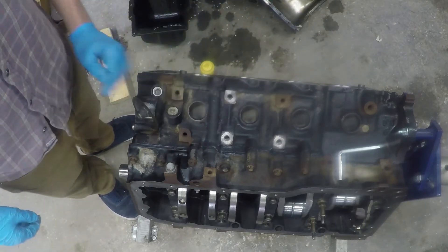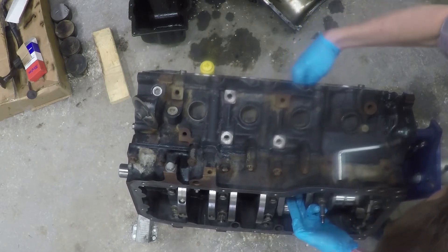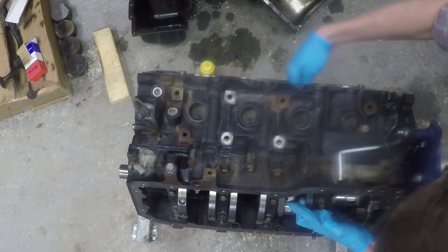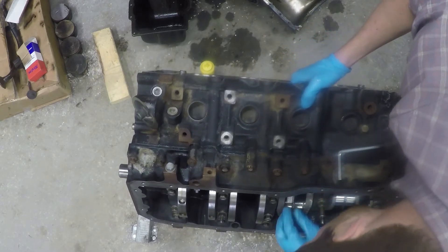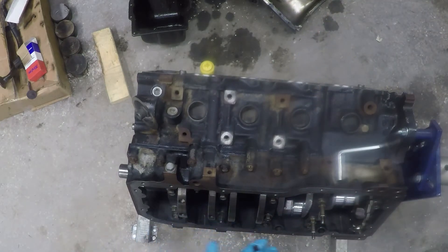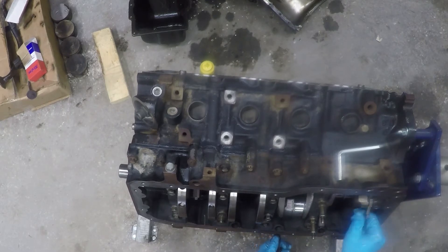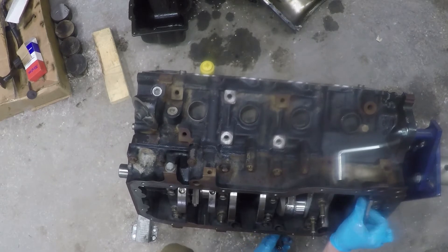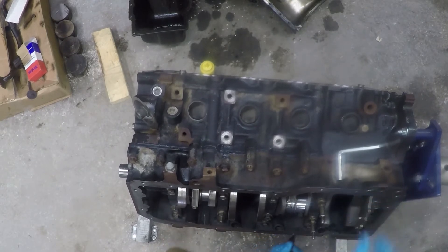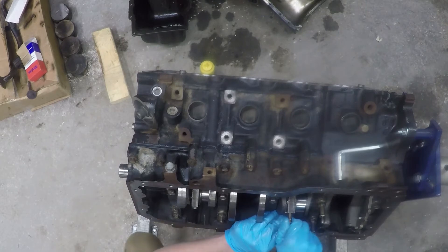Using that rubber handle is good too — I don't want to damage that surface, so I'm just tapping it really lightly, tapping with like the ends of my fingers, guiding it into that position. You want this to line up the correct way so you can see that this mark lines up with that mark. That will actually help push your rod against your crankshaft so you know you got a good solid fit.